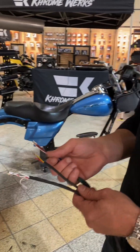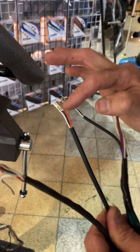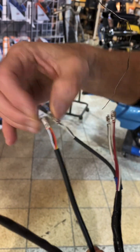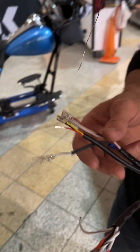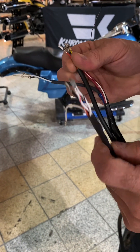The other important part is, you're going to notice on the terminal ends — you can see they're stepped down a little bit. I'm going to use my stainless wire to wrap around the heads of these, so when I pull them through, I'm only biting the terminal ends, not pinching into the wires. So you're going to bunch these together, like so.